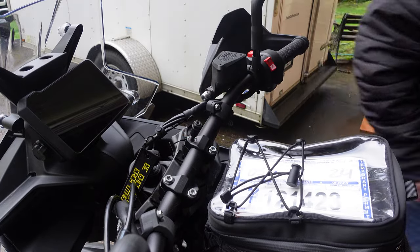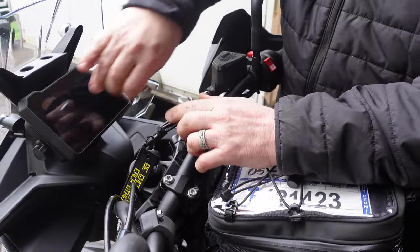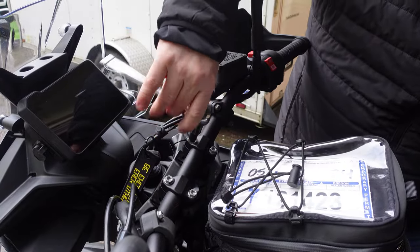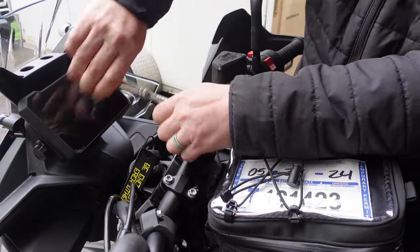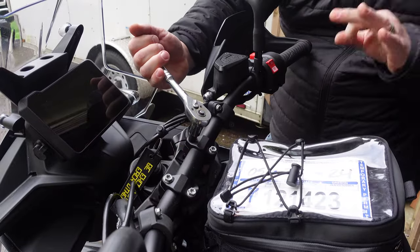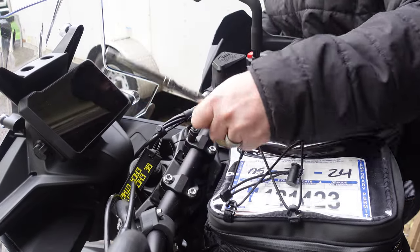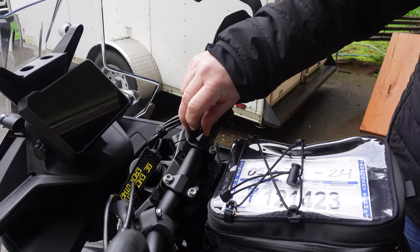It's a 13. Don't you know the rule — it has to be an 8, a 10, or a 12? This is 13 stuff. That never happens. So this could not be simpler. The nice thing is all of your dual sport and adventure bikes have handlebar clamps. They maybe aren't all M8 bolts, but most of them are. You should, if you're installing this properly, go look up your torque spec and make sure this is torqued properly. But generally I just go with a 'Guten tight' and call it good. We're going to put the head back on that. Voila.